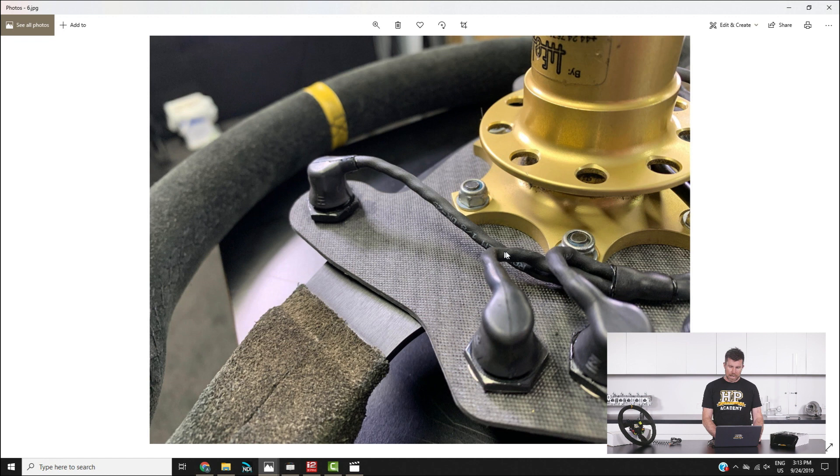This is the back of the steering wheel. We used 22 gauge PTFE wire for our harness and as you can see it's all covered in DR25. Once we've soldered the back of those switches, we've also installed Hellermann heat mouldable boots, which provide strain relief and support for that wiring. It's the vibration and relative movement that really causes havoc with solder joints, so if we can support those wires and make sure they're not going to move around, this will give us a long term reliable result. Where we've spliced three wires together we've used a section of SCL semi-rigid heat shrink over the top. Once all of this is complete, the wiring harness is also secured to the steering wheel with silicone to glue it down and prevent any relative movement.